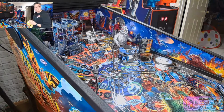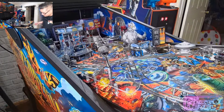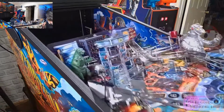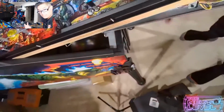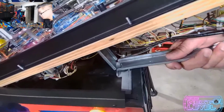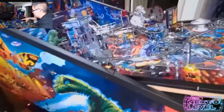So by the end of the day, this is going to get really, really audited throughout the whole life cycle of having this machine. Okay, so we're going to lift up the playfield. Like I mentioned, we're going to stick it here. We're going to pull it all the way back and then have this last part up on this part here too. So we're going to lift, and this bar is going to sit right on the edge right here. The first thing it says to do is to make sure that this bar right here, just make this a little bit lower so you guys can see it, is sitting on this back side of the lockdown bar. That way it's secure. And then we're going to lift up the back side so the playfield is nice and straight. So that's step number one. So let's go ahead and get back there.